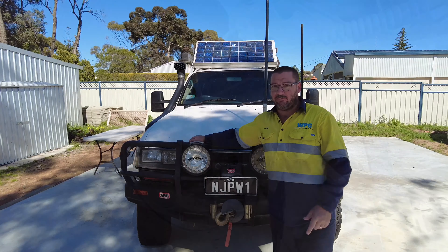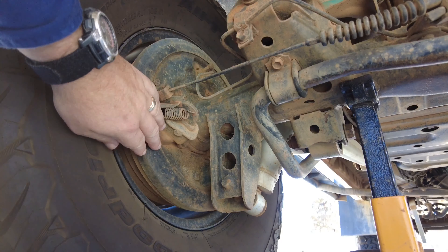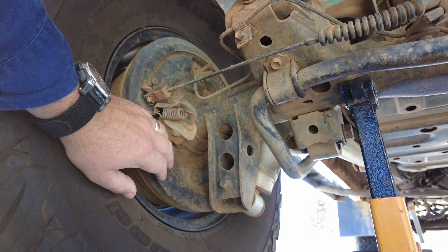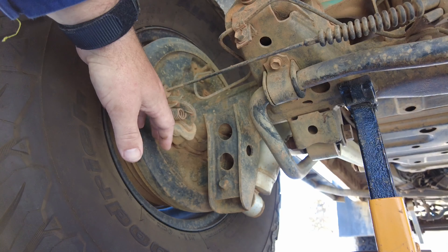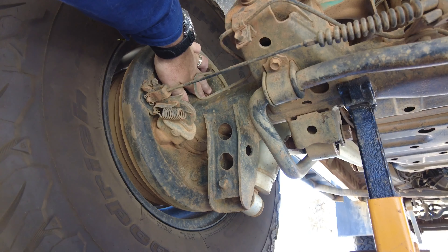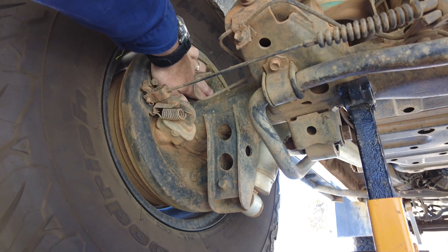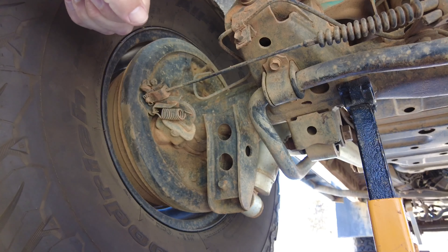Here at the rear — this is the rear left tire — you want to look under here for any oil. If there's oil dripping, you have an inner axle seal problem and I'll have to make a separate video to cover that. Up here there's a little rubber plug; not all Land Cruisers will have these, they get lost quite often, but you can get them from any brake place or Toyota. Even ones from a Hilux fit a Land Cruiser. We'll be removing this rubber plug and the wheel to begin the adjustment.